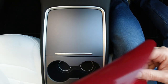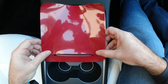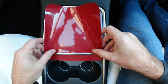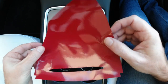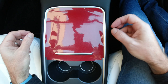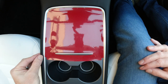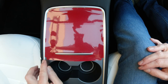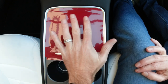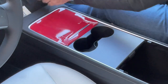As you remove it, just use even pressure and go slow. This vinyl has been in the car overnight so it's nice and cool — not too stretchy or floppy. You really need to get over the top of it. Use the handle as your alignment guide and just be gentle. You can see it's very easy to lift and drop until you get the positioning exactly right. We're looking for alignment around the handle, and on these edges we're looking for just a little bit of overlap all the way around — about a millimeter, maybe a little bit more — and this will all tuck under once we completely install it.